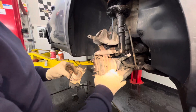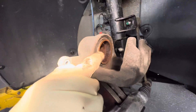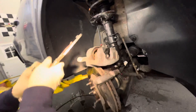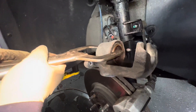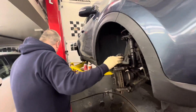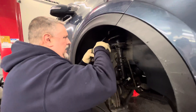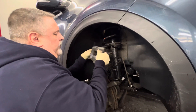We're going to take this bracket off for a second to see how the piston has collapsed all the way. If you find it's not collapsed all the way, get in here with a pair of vice grips and gently finish crimping it down. This one's bottomed out, so we took our time. Now we're going to bungee cord the caliper up to the spring to keep it out of the way.